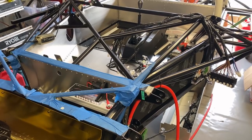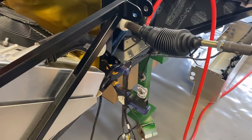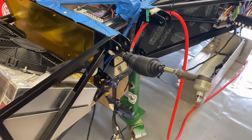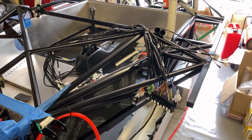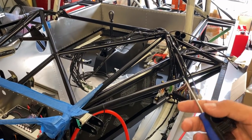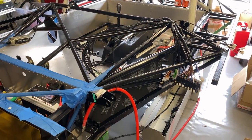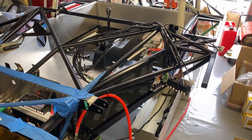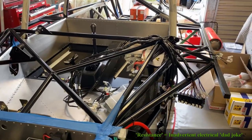future. And also, you know, as neat of an install as I possibly can. I'm not doing any fancy wire tuck stuff, particularly this wiring loom that runs outside here. I probably would have preferred that was encased in a Raychem type insulation, which is basically a really heavy duty shrink wrap, and they were all properly weather sealed. But, you know, you have to pick and choose your battles in that sense. My original thing for this is I would have liked to have built my whole wiring loom myself, but it just seemed like too large of a job and probably a bit outside of my area of expertise. As it transpires, I'm going to end up being probably deep in the engine side wiring loom a lot more than I ever expected to be, but be that as it may, it'll be a good learning experience, even if there is a bit of resistance from me at the start.